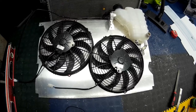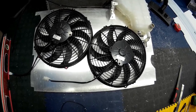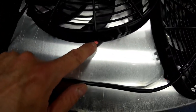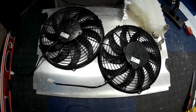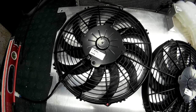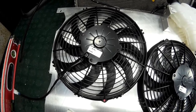Now we've positioned our SPAL cooling fans onto the shroud — as you can see, there's not much room for anything else on there. Once you've done that, mark out the bolt holes using a permanent marker to drill for mounting, and then mark for cutting around the inside of the fan shroud for the airflow.